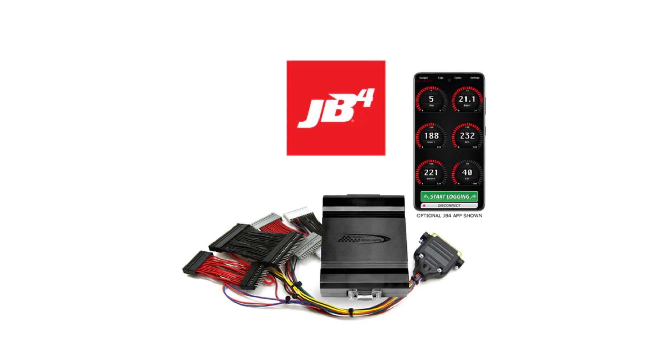When it comes to tuning, there are two primary options: the JB4 piggyback tuner as well as MHD flash tunes. The JB4 used to be a lot more popular and gets a little more hate nowadays. Jake and I both run the JB4 on the single turbo 135i and my upgraded twin turbo 335i with great success. That said, sticking with a flash-only tune is generally considered the better route, and we tend to agree. There really isn't a wrong answer — both MHD and JB4 are great tuning options for the N54.